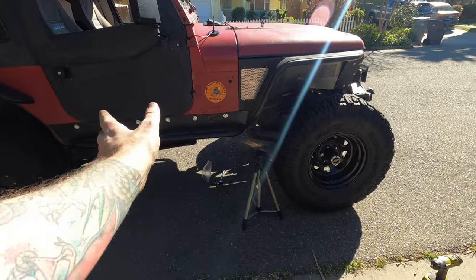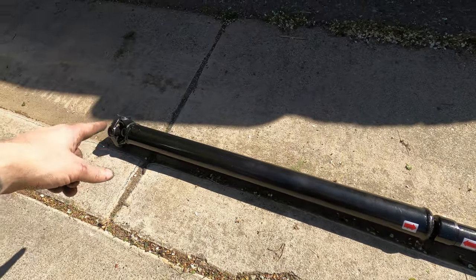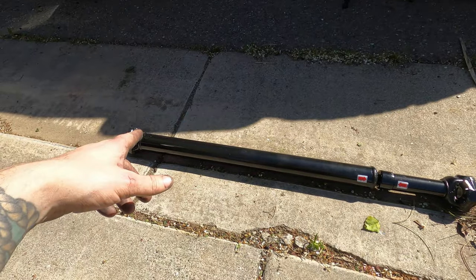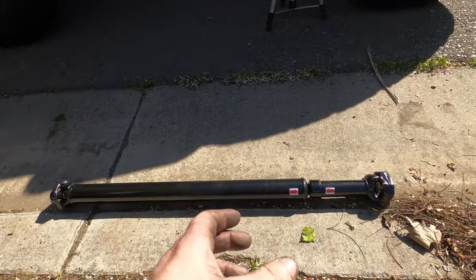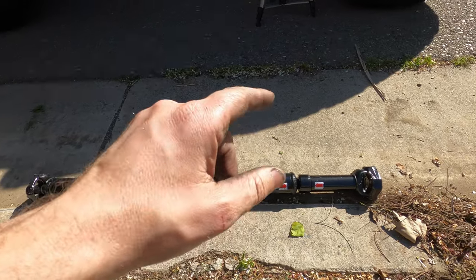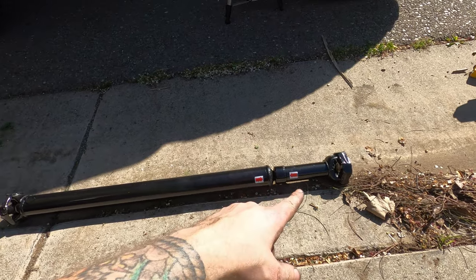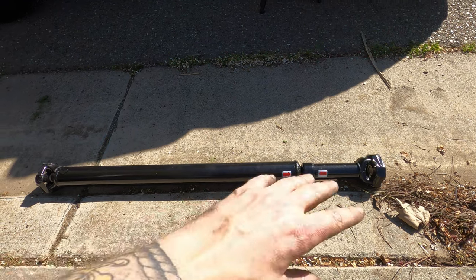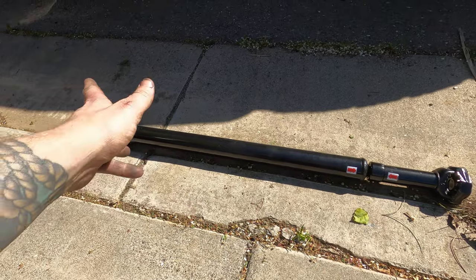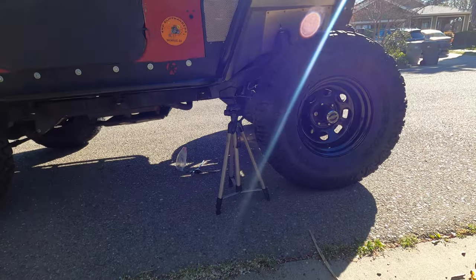She's out of the garage. We moved the axle four inches forward in the front, so we needed a new drive shaft. I went to Sacramento Driveline — now I see why everybody likes to use them. I went in, told them I needed my drive shaft lengthened to a specified amount, I think it was 42 and a half inches, and I was looking to get a few more inches of slip on the end. They said I'd need a new slip yoke, which drove the price up a little bit, but even being backed up they got the drive shaft out the next day. I picked it up — they threw new paint on it and put new solid U-joints on there. Hopefully I measured right.